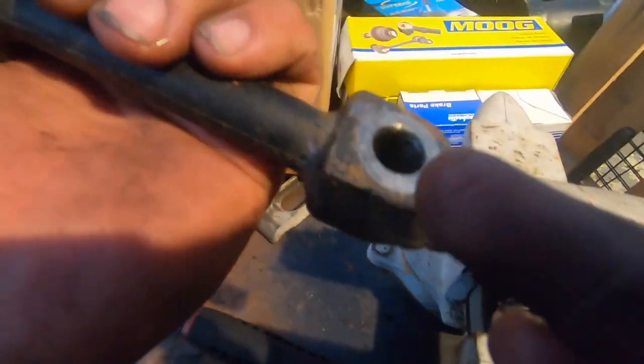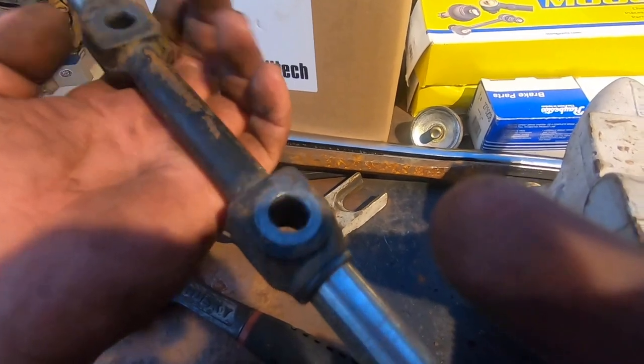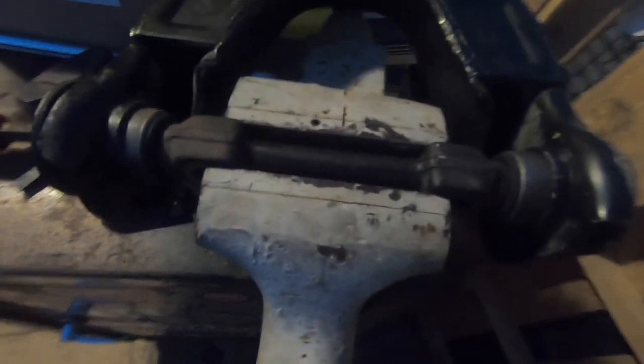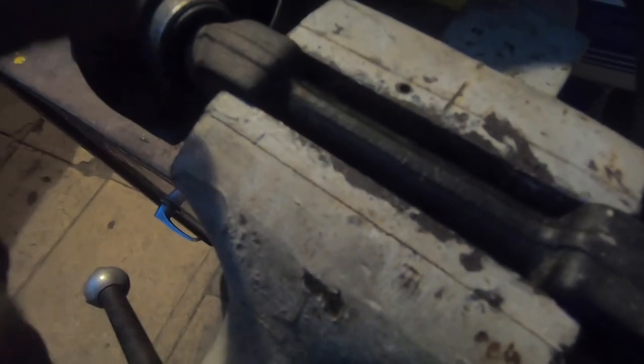This side has the wear of the washer and bolt head. I was able to put both of them in but damaged the edge of the bushing housing a little. They went all the way in — if it gives us problems we'll order brand new control arms. It's a hassle — easier once you get the first one out. Taking them out you just hammer them out, but putting them back in is tough. We'll just slide them in and install them.